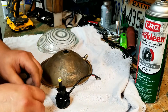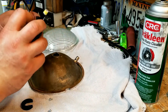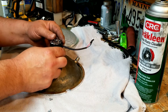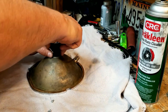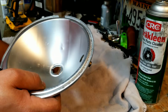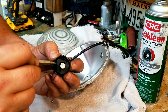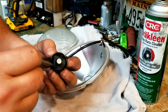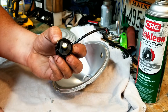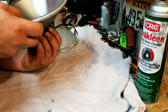I'm going to pull these little screws. These indexing pins help align and center it in here. Let me line the holes up — I'm going to have that pointing down. I also had to modify the mount for the H1 — I just ground these edges off so that the two screws would clear the H1 bulb. You could actually drill those holes for a more positive index, and if I replace these with a more expensive bulb I probably will.